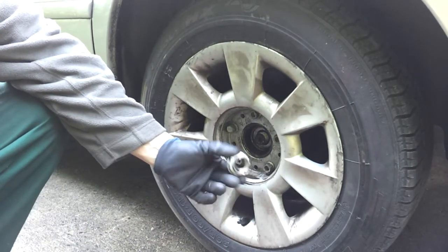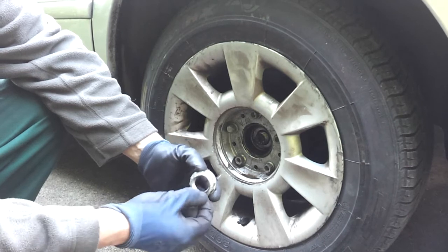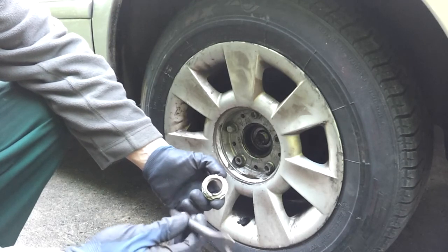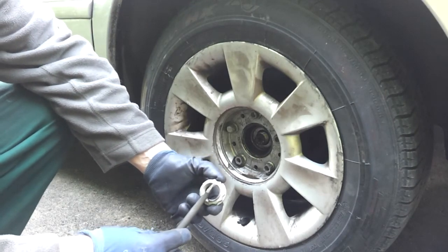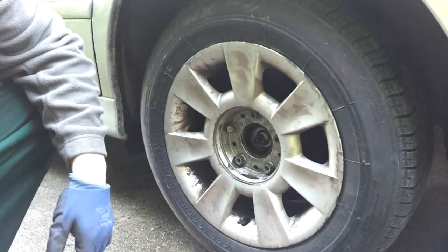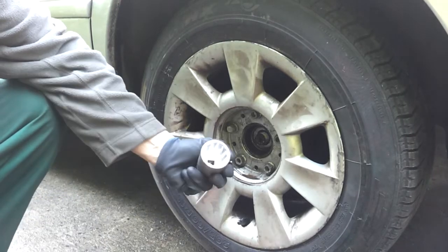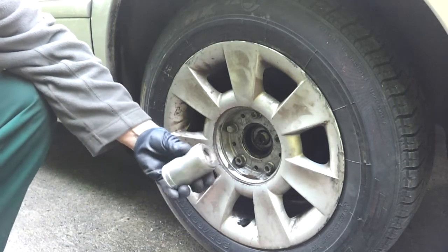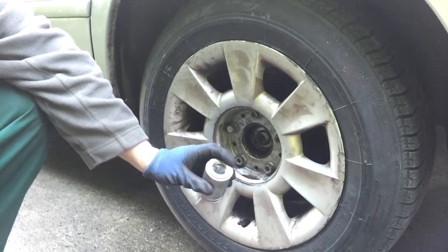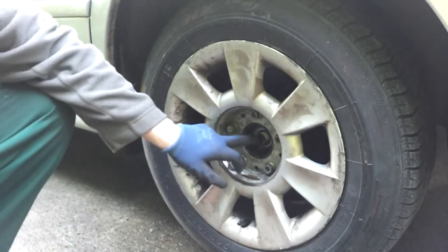...is to take off the nut. Now that is a nut that has these little tabs on it, so you have to bend those back. The way that I found to do that was just a little air chisel tool — just tap it with a hammer and put those tabs back perfectly fine. Then you need a 36 millimeter socket and it's got to be a 12-point socket to fit that nut. It has a fair bit of force on it, but I got away with probably about three feet of bar just on a socket arm — cracked it off, spun off perfectly fine.